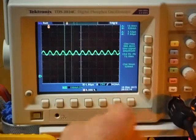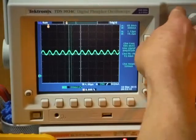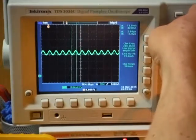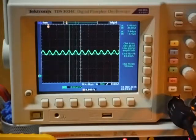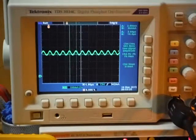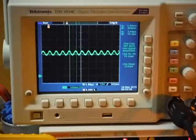It's switching at... let me do a little bit of math on that. The Tektronix scope doesn't do a good job of pulling out the frequency. So 3.44 microseconds for the period — about 290 kilohertz.